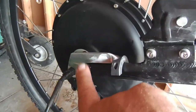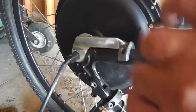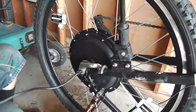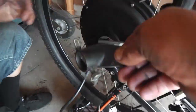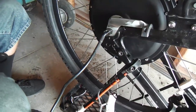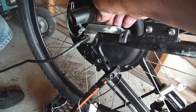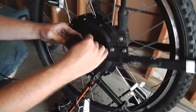Okay, there you go. See, it's not a flat piece because this protrudes out, so we had to skew it by cutting this and welding it a little off center. But it seats down in there real nice now. But we have another issue. We have this trailer fitting, and it used to go over the axle, and there's not enough threads for it to be used that way anymore. Plus, the connector, we don't want this dangling around. So we're going to add a piece of stainless steel for this to ride on. I just wanted to see it laid up here though. But that's about what we'll want.